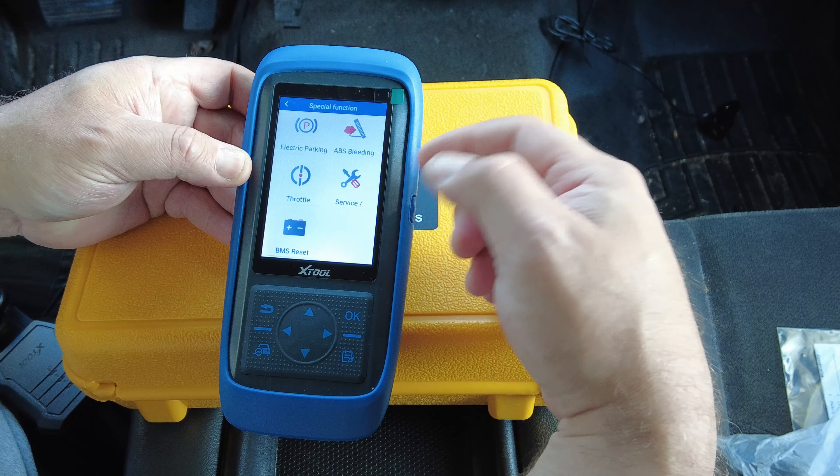With the hood open now, let's go into fan relays. On this truck I have fan relay one, and I can turn on fan one, fans two and three, or fans one, two, and three together. Let's try all three — you should be able to hear those. Enter the function, issue the command, and then shut them off. That works pretty well.